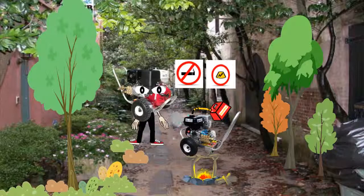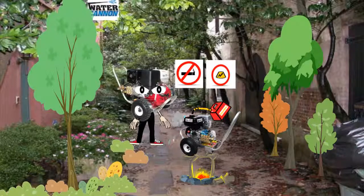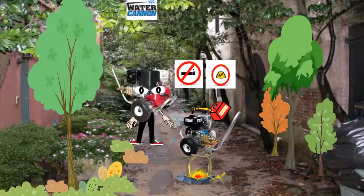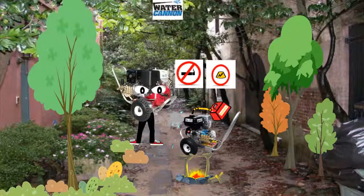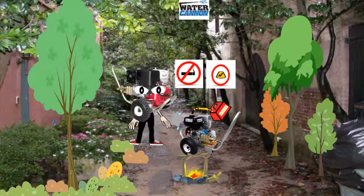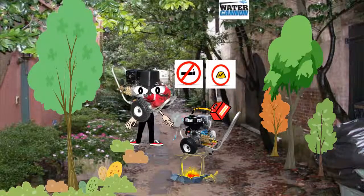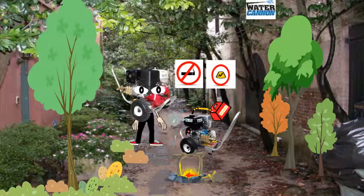A circuit dedicated only to the electric pressure washer is recommended. This circuit should be installed by a licensed electrician and checked to supply adequate voltage under load. If the distance from the panel is too long, the wire size is too small or the voltage is initially too low, this will cause the GFCI or thermal overload to trip. If this happens, consult your pressure washer supplier. Do not use an extension cord. Use only the factory supplied power cord.